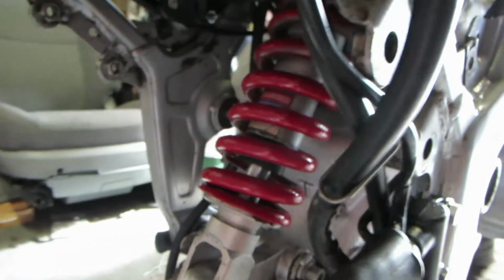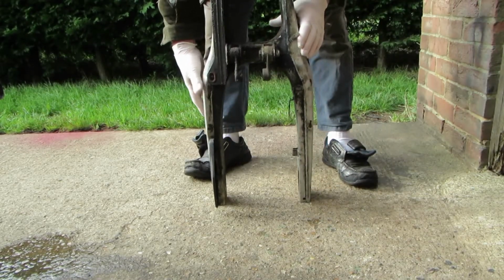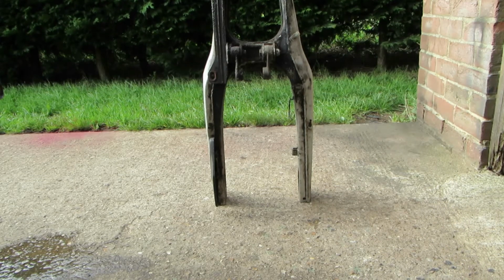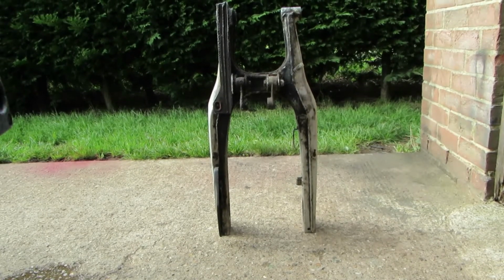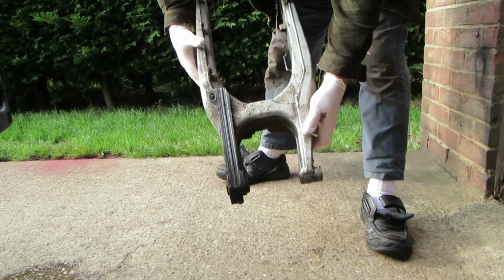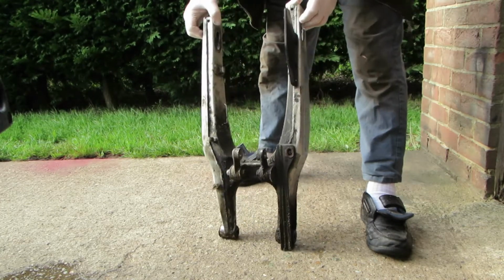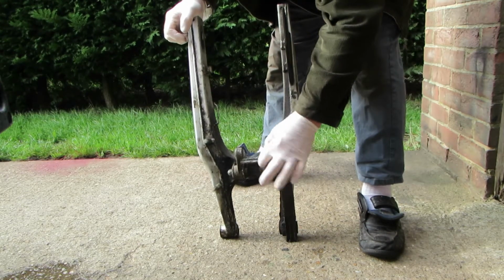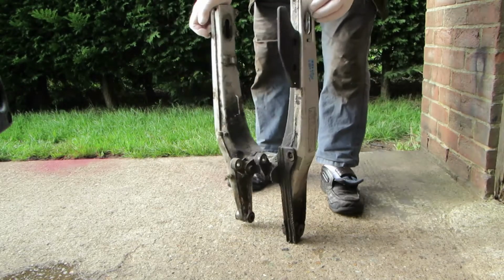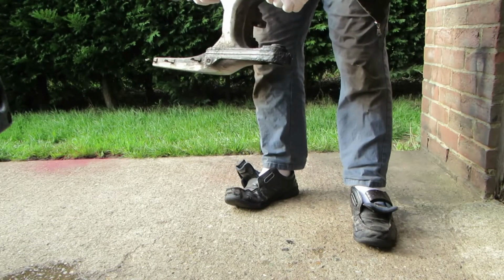Be time to clean up the rear wheel. It's the swinging arm. We can see what a mess it is. And the good thing is, knowing what we're dealing with to start with, means we can see the significance of the change. So the first thing obviously is to clean it, remove all of the bits and pieces so that we can then check that the bearings are in good condition. They feel nice. And then give this a real good dousing over, jet wash, and then repaint it, prepare it for re-installation.